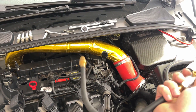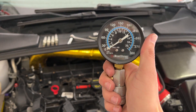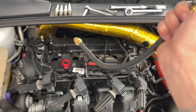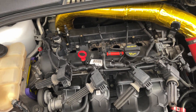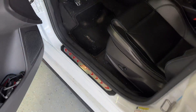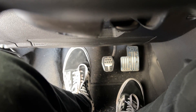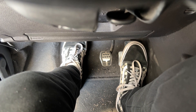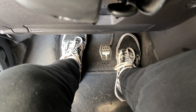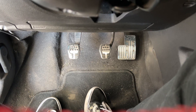I'm doing this solo so I don't have someone to hold the gauge and tell me when it stops going up. I'll have the compression tester screwed in on one cylinder. Since my car is a manual, I'll need the clutch pushed in at the same time. You want to put the gas all the way down as you start it — floored — so the car knows what you're doing and won't spray fuel into it.